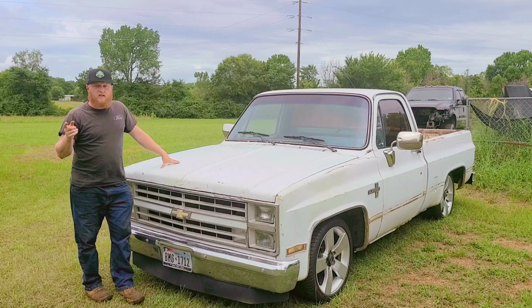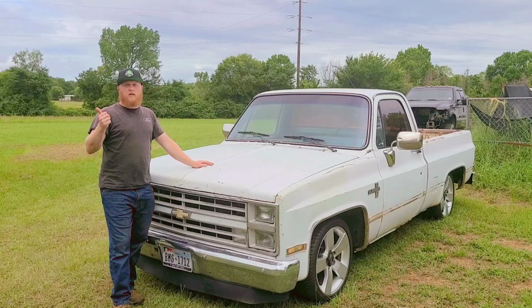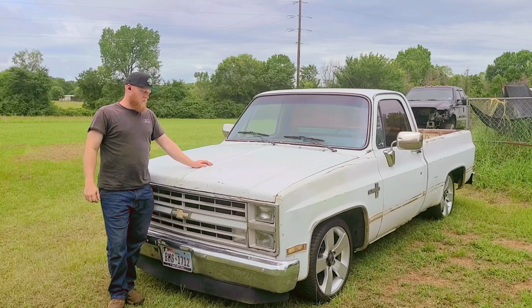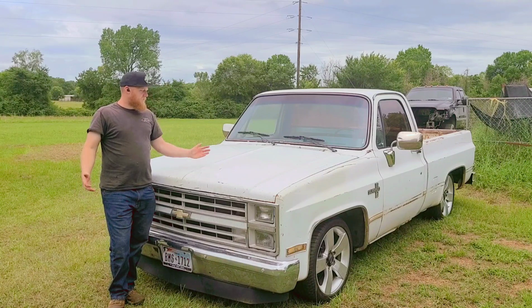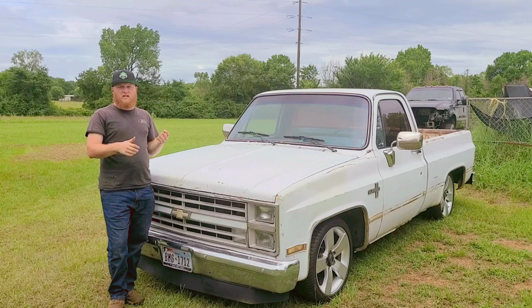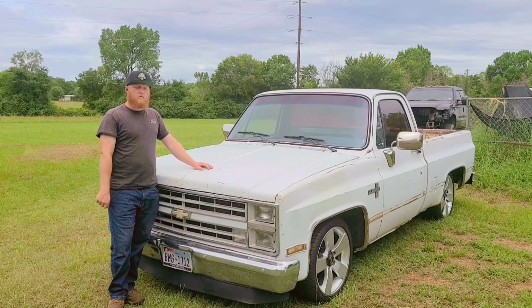I've still got that other truck's parts I'm going to sell, and still got the other motor. I'm probably going to rebuild it. As I said, I'm pretty sure it's just spun a bearing, so hopefully the crank will be okay. Worst case, I got a couple of short blocks to steal a crank out of. But this is it. Next one probably be more C10s. I got another 3 short beds. I got 2 crew cabs. I still got to finish that Cummins one.